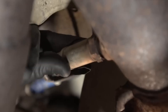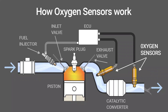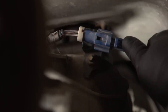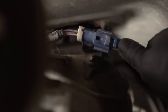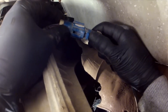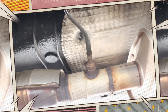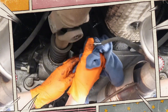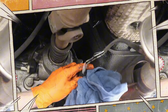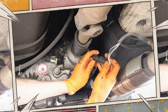How to fix: It is typical for unskilled technicians to replace the O2 sensors quickly if your code is P0140— avoid doing it. The computer cannot receive the oxygen sensor's reading even if all of the sensor's functions are performing as intended. This is due to the fact that a P0140 typically indicates a bad wiring connection. Verify again that everything is plugged in and see if any connectors in your car are broken. Next, see whether the oxygen sensor is powered on. This will enable you to determine which side of the connection issue the problem is on. If the problem is related to power, look for breaks in the wiring and the fuse. The issue is most likely a line break between the oxygen sensor and the ECU if power is present at the connector.